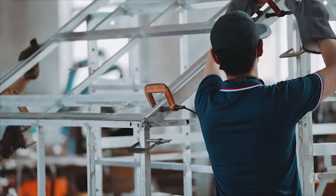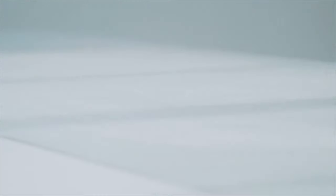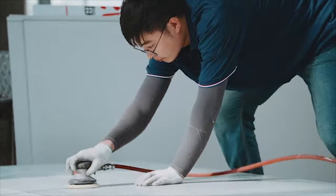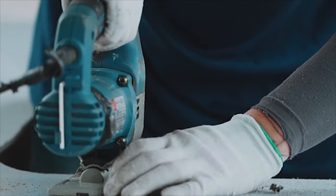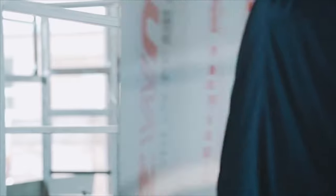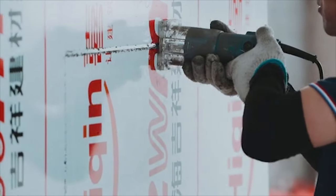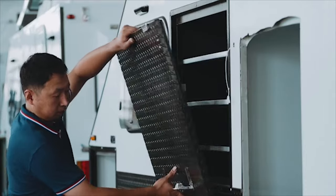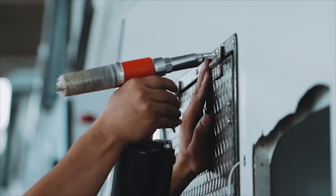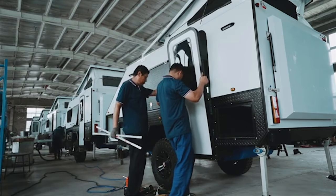You can see here the aluminium frame, which is the base of the body. The frame is welded, bolted, and screwed in place to make a one-piece structure that moves in unison with the chassis it's mounted to. The walls of the body are made of aluminium composite sheet material and they're routed and cut into shape. The walls are fastened onto the aluminium frame with industrial adhesive. The aluminium locker doors are all pop riveted to the frame. The doors and kitchens are installed as the final part of the process in China.